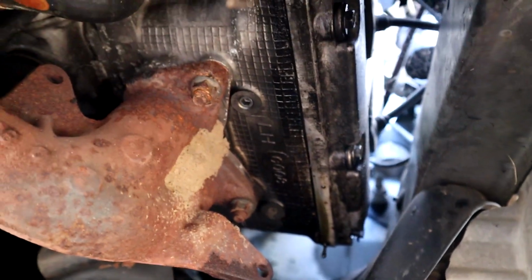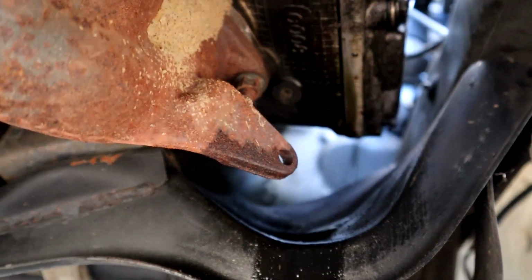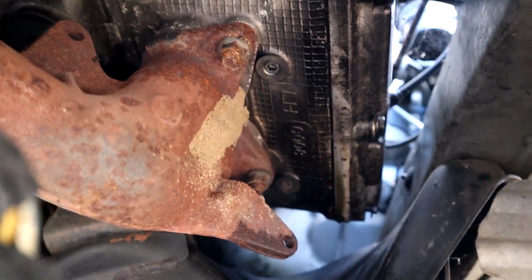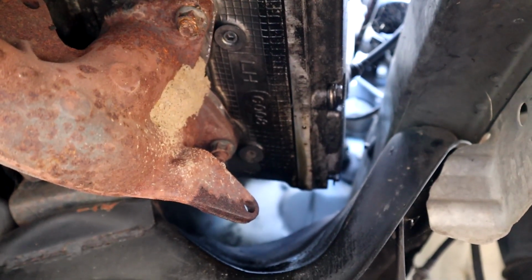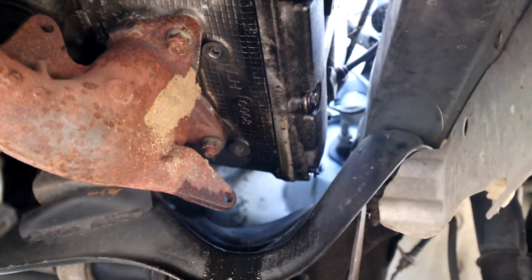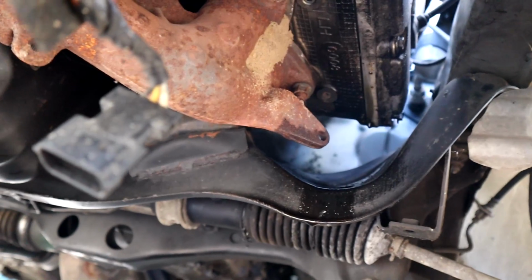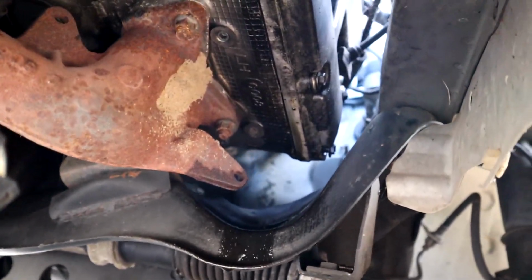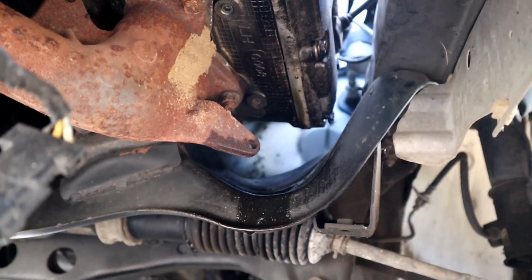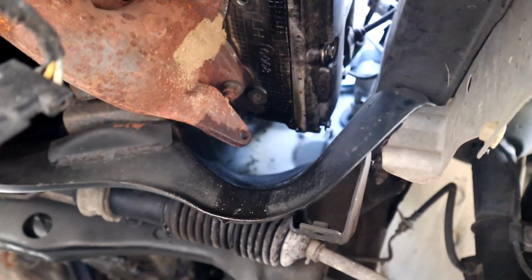So I pretty much found out that the reason that back one is leaking so much and that's not tight is because there's those little golden washers you can kind of see in the center of frame there, and that washer down the back isn't there, so essentially that bolt isn't actually clamping at all. So that's what's going on there. Gonna tighten all the other ones, chuck some washers behind that one at the back there, tighten them all up and see what happens.